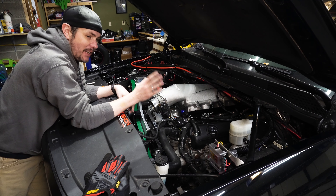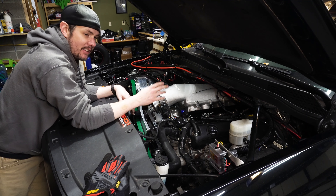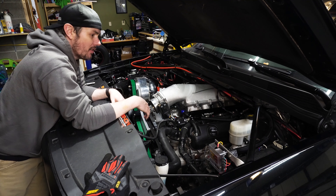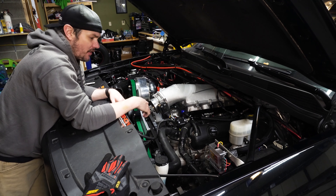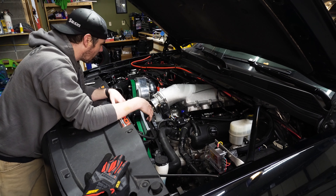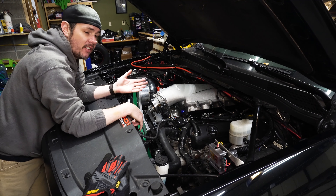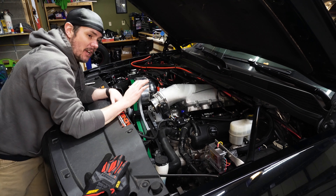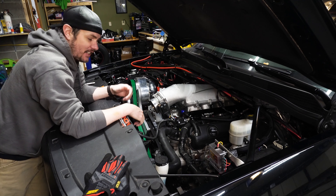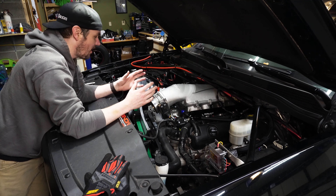To do that, we need to add a couple of pins. I've got them over on the desk and I've measured everything out. We're going to pin up the connector for the fuel pressure sensor, tie it back to the micro squirt, and then jump into the software. I'm using the TPS wire since we don't have TPS on this. I don't know if you can set it up without having the advanced version of Tuner Studio, but I went ahead and bought it. It's a hundred bucks to unlock all the features. It has a pretty simple interface for choosing your input and putting in your scaling. In this case, 0.5 volts is 0 PSI and 4.5 volts is 100 PSI, so it should be fairly straightforward.